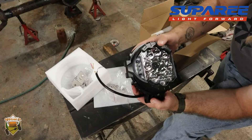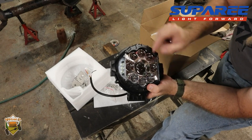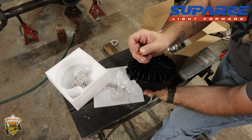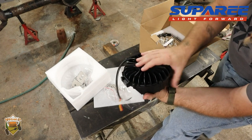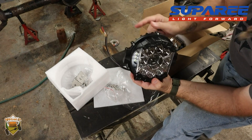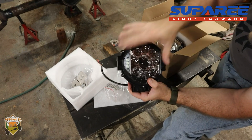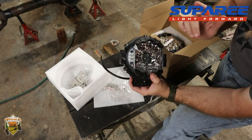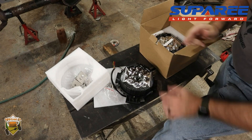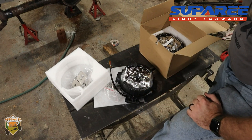You can see there's the center array of lights, the side lights, and a center daytime running light. There are three wires on the back. Looking at the product listing on their website: if you connect the positive and negative, you get the normal driving light and the side shooters. If you connect the yellow wire and the negative, you get just the daytime running light in the center. You can also power all of them at once. I bought a switch panel so I might wire them up separately, but you could twist the yellow and red together if you want them all on simultaneously.